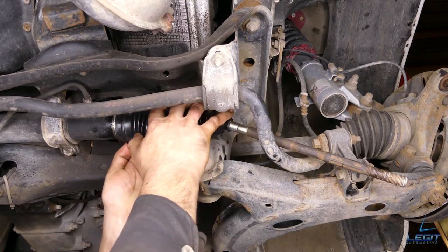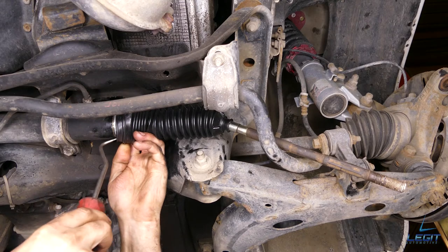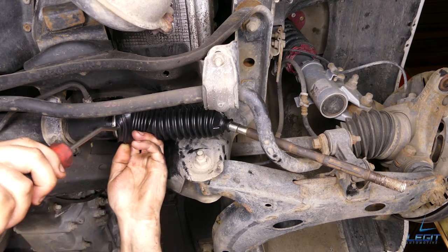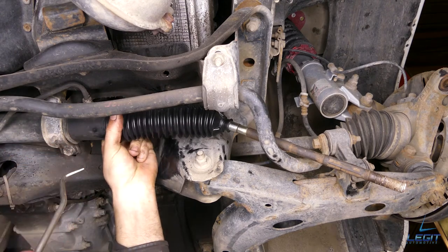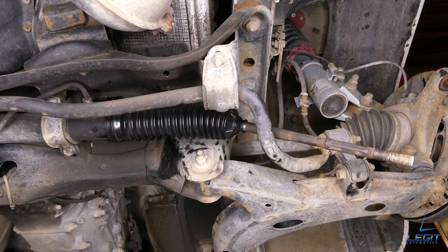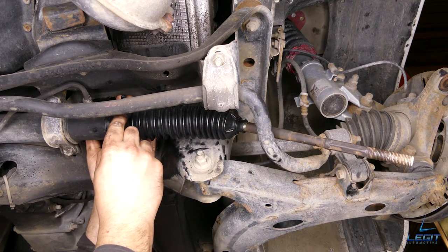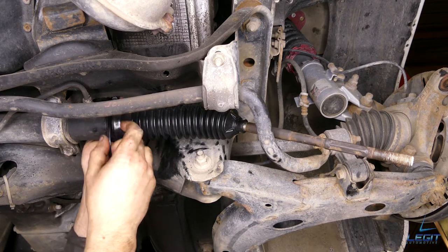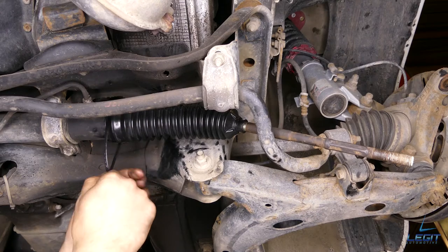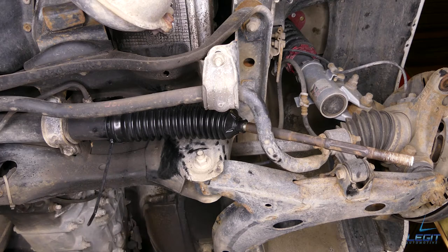Let's bring it close. Start it on one side. You may need a hook tool like I'm gonna use right now. Should come right over. Just like that. And so on this kit, they sent us some tie straps. So wrap it around. And that's what's gonna tighten down the boot to the rack. There it is. And then cut the end off.